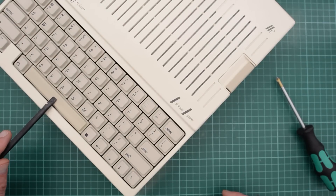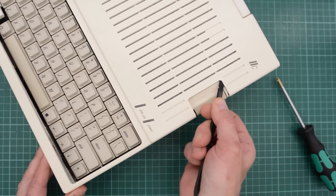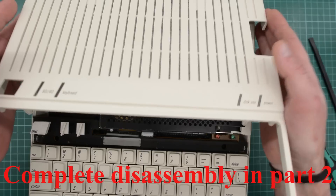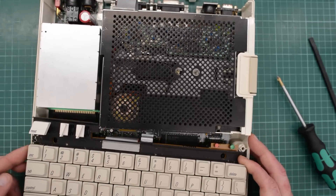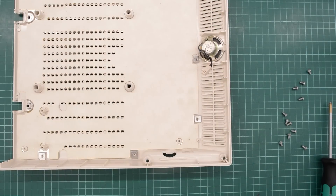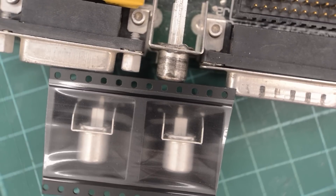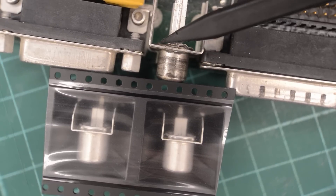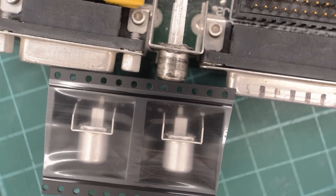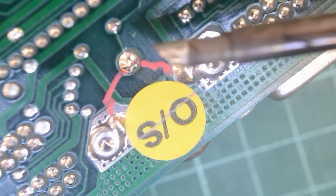By the way, if you're playing along here, there's one tab underneath the space bar, and then there's a tab over here close to the floppy drive. Let's see if I can remember how to take these apart — and it's out. So here's our suspect connector and here are our replacements: similar but definitely not the same. These connectors are known to go bad, and in one of the previous videos I have already added some solder to the connector. That is the common fix. But as you saw, that didn't solve our problem. Let's remove it and see if we can fit one of the new connectors. I guess we could add some fresh solder while we wait for the desoldering gun to heat up.